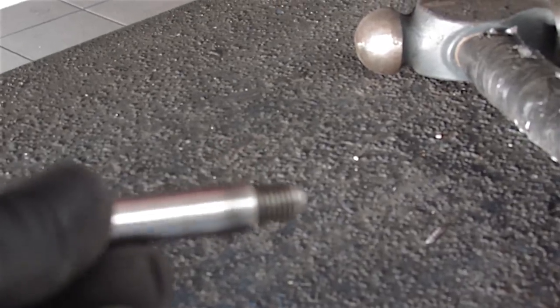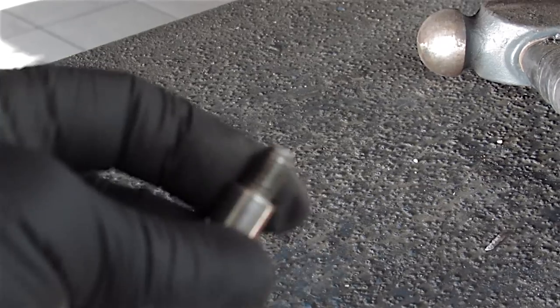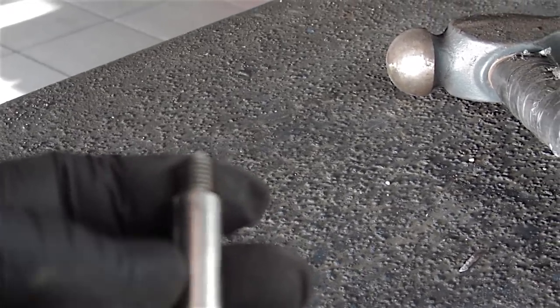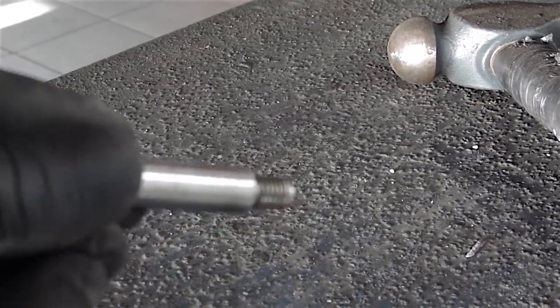One last thing before I shut up about these rear brakes, your sliding pins here. Give them a clean up on the wire wheel, because rubber will get stuck to these actual sliding bits. And if rubber's stuck on it, they can actually make your brake bind a little bit if you're not careful. So make sure they're nice and clean, then you can pop them back in.